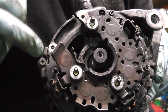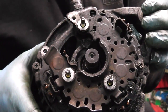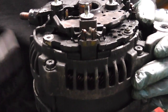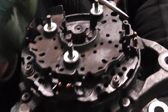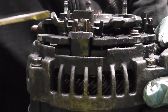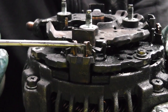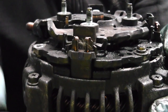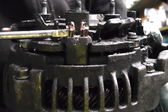First, remove the Phillips screws — one here, one here, one there. There are only three Phillips screws holding it. After that, there are six wires coming out of the stator joined to the rectifier; they're paired in two — two here, two there, and another two there. The simplest way to disconnect them is to get a hacksaw blade and just slice them just underneath the solder bubbles so the wires become loose.